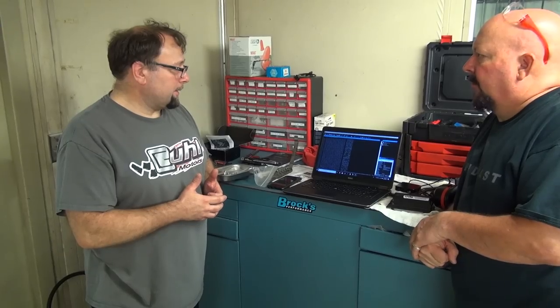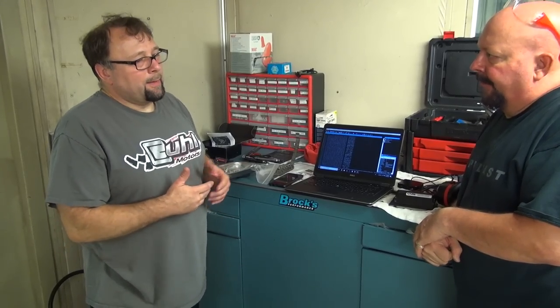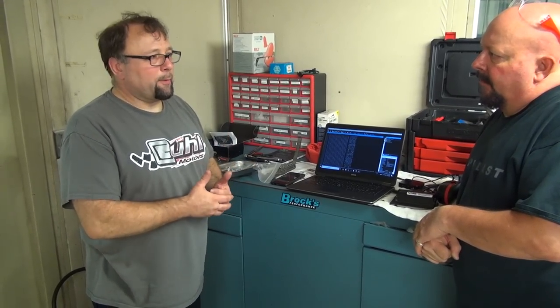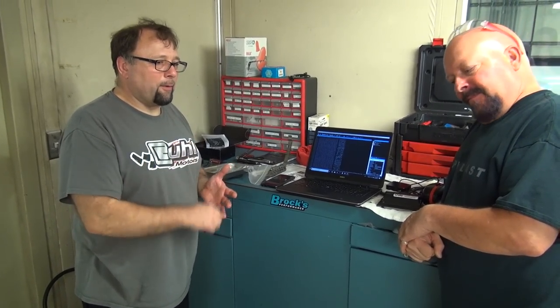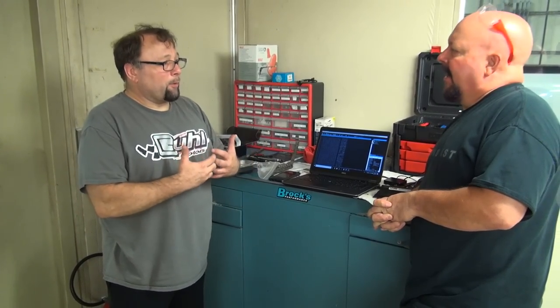There are a lot of things that have to be checked, double checked and validated. It used to be we could do it pretty quick because there were only a couple of fuel maps, a couple of ignition maps, some rev limits, a speed limiter, and that was pretty much it. But with these new bikes, with the noise abatement, wheelie control, traction control, launch control and all those things, it just compounds more and more, and it's all woven together too. The traction control system is now woven into the actual fuel injection system, and they work in conjunction, and possibly with the throttles and everything.